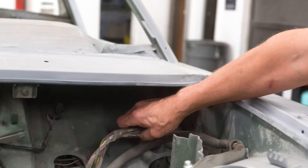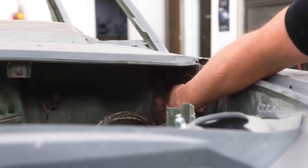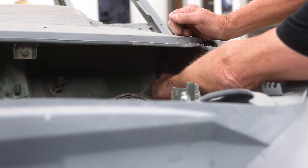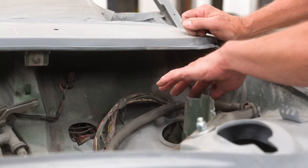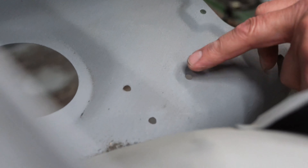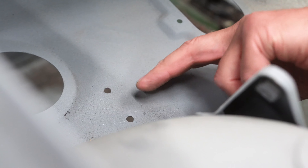The cowl section here was basically the same except in 72, for better ventilation, they added two side vents, which we call air conditioning vents — just as a friendly term, that's not air conditioning. It modified this front panel to hold those, so you'll see that the 72 through 76 models had a different cowl panel here. Over here, these are three factory holes that the four cylinders don't have — these are holes for the windshield washer pump. Six cylinders had an electric windshield washer where four cylinders had the tire-actuated pressure pump.